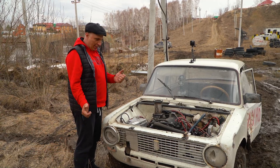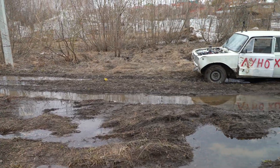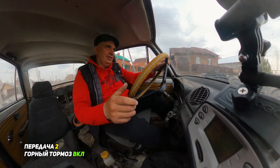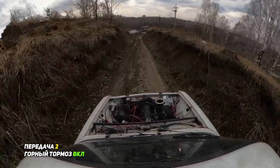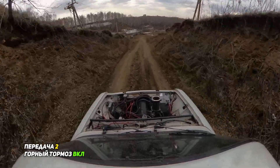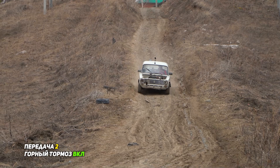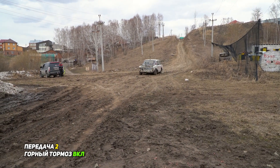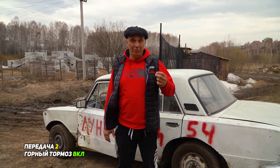That's why I suggest we go back up and test the retarder in second gear. We're gonna be in second — trying the engine braking performance while in second and with the retarder engaged. Decelerating. Now you can definitely feel it — you can really feel the rear axle slowing the car down. To think you get that effect by merely blocking off the exhaust. Now with this being so effective in second gear, out of curiosity I want to try descending with the box in first, and see how it does without the retarder engaged and with it working.